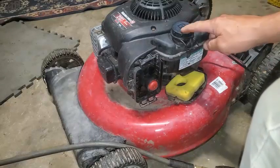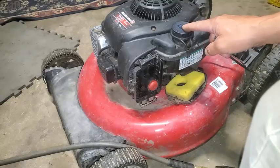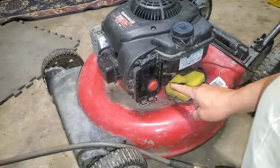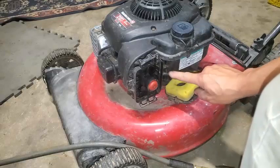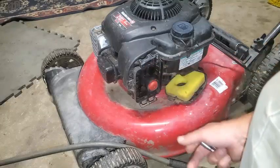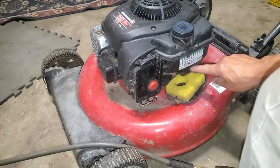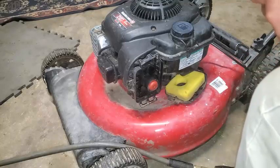This is full of fuel so we want to go ahead and block that off. Since I'm going to have it disconnected, I'll probably go ahead and drain some of the fuel out and take a sample, because if there is any water in here — which is really a possibility and most likely what's going on here — we'll take this fuel line off, take the carburetor off, and drain some of that fuel out to see if there is water. If there is, it'll be collected in the bottom of the gas tank and at the very bottom of the carburetor float bowl.